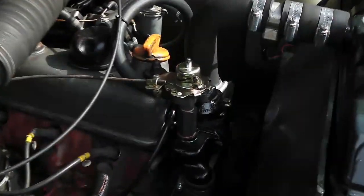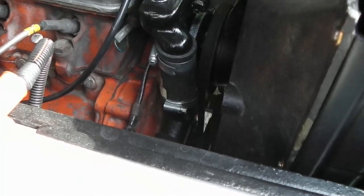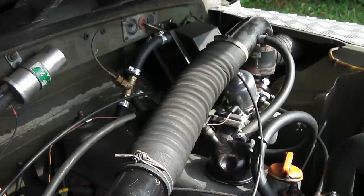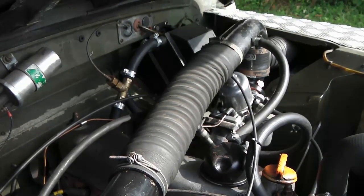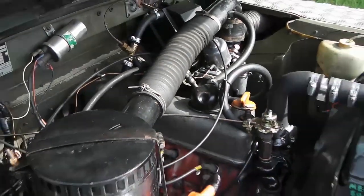You can see we've got a new heater valve. Basically all the heating and cooling system has been gone through — new heater matrix, as the old one was a bit dodgy, and the motor in the heater has been rebuilt. It runs about twice as fast as before. So it's all just a bit tidier under the bonnet.